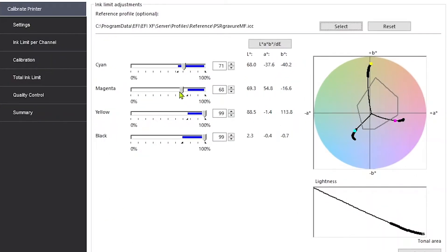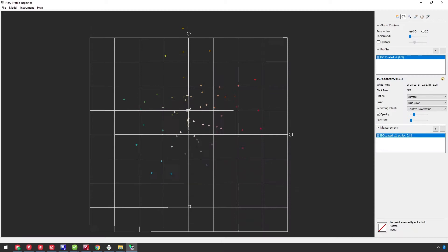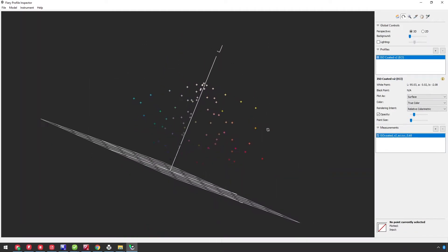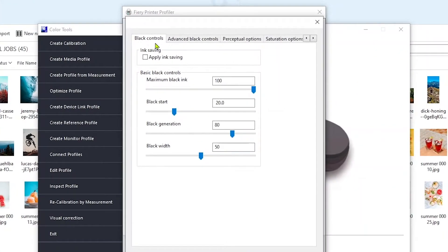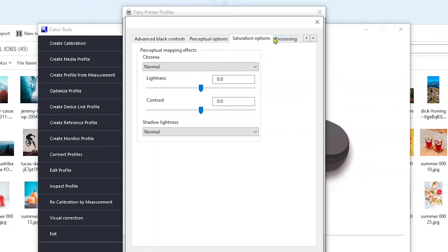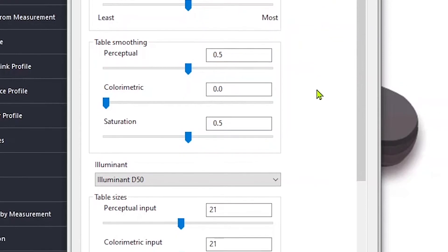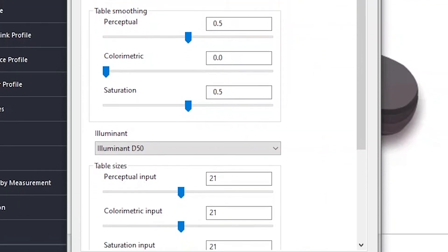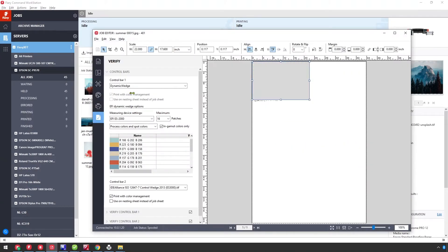Inside this tool, you also have plenty of manual intervention or modification possible. The next step after your printer is in an optimum state would be to profile it, which is basically just taking a snapshot of what that newly calibrated printer looks like. So immediately after calibrating, you'll be taken into the profile step. This uses an integrated version of Fiery Color Profiler Suite, which is a full-featured profile application. As an example of the constant innovation put into Fiery, we have a new profile engine called Fiery Edge. This profile model is highly accurate out of the box — you'll get a much tighter color match with your printer profile. Once you have the calibration and profile done, you've really created a media set, so whatever color you throw at it, you can expect good results.